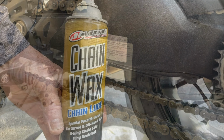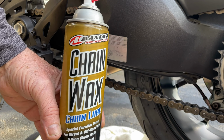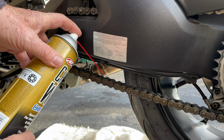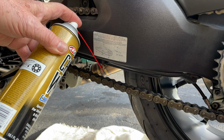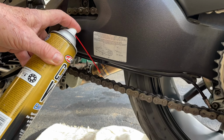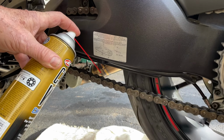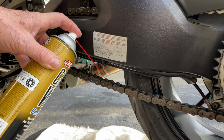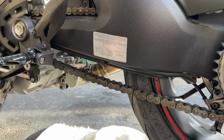This is the chain lube that I use. I'll leave a link in the description below so you can check it out yourself. You basically put it on the chain with the applicator right here and turn the wheel as you're dispensing the chain lube onto the chain. You make a couple of revolutions on the chain and then it's properly lubricated.